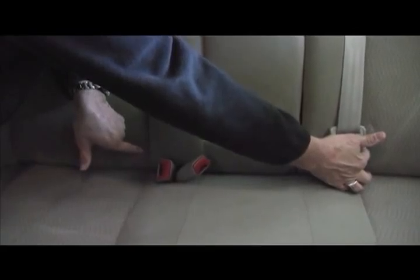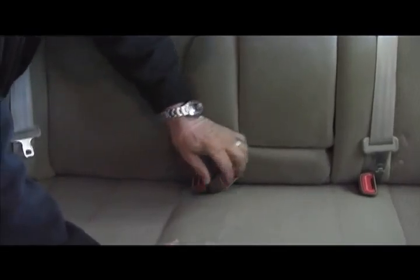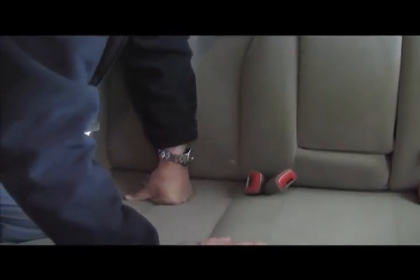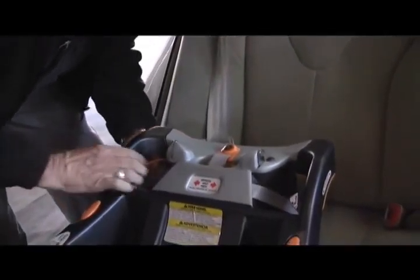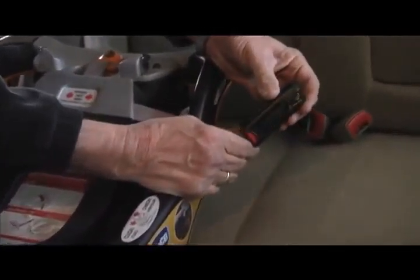You go 11 inches over — or 11.02 inches to be precise — and there's another button. Put your finger directly under that button and you can feel the hook. What you do not do is take this hook and the hook for the adjacent seating position and create your own center. You have to either hook here or hook there, unless you have certain vehicles that allow latching in the center. Incidentally, LATCH is an acronym for Lower Anchorage and Tether for Children.